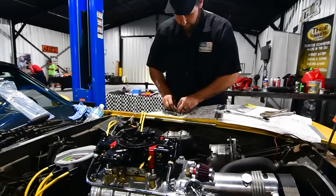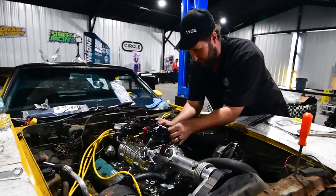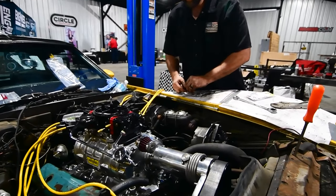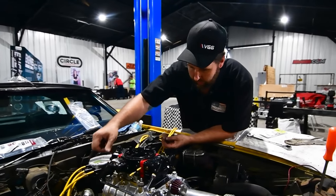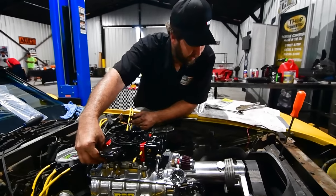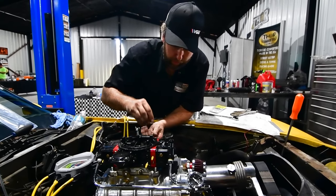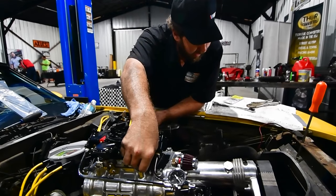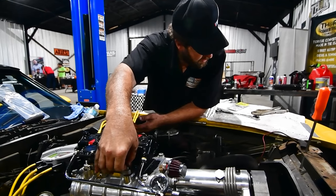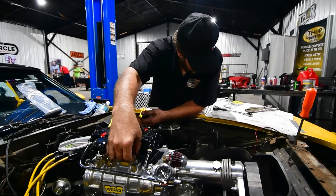Boom. We've got a fuel make it happener. This carb was custom built and we powder coated it to match my 72 Chevelle, which I no longer have. But it's a boost referenced carburetor, which you want to make sure you have when you're running boost. And pull through and blow through are different applications too. Guys really got to pay attention to that. And then make sure you drop one of these nuts down onto the top of the transmission where you're never going to get it back.